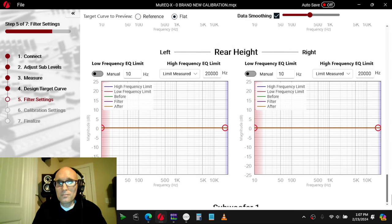I'm going to need my phone because I'm sure we're going to need to increase volume as well. Not actually far off. Yeah, we're still recording. Doesn't matter. Not too far off. I am stopping the disc, and the reason is because with this app specifically, or in general, if you're making subwoofer volume changes on a phone and you're not using an analog control to turn and dial things in yourself, and even then, I think you should turn the subwoofer or the test tone off just for safety reasons.